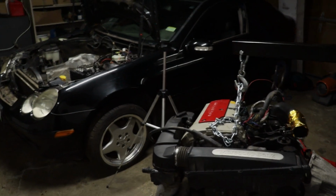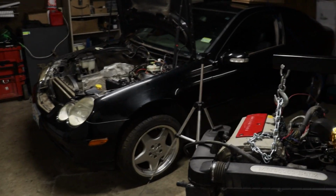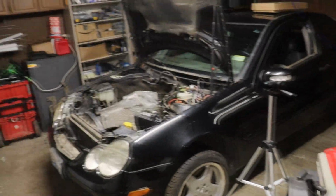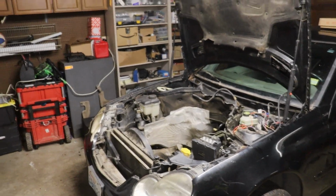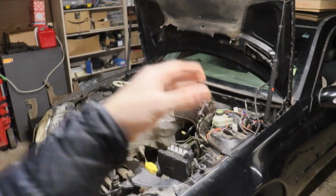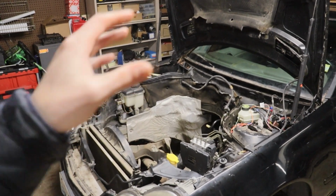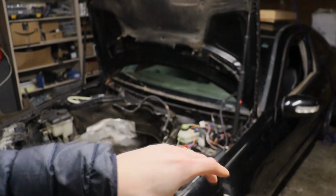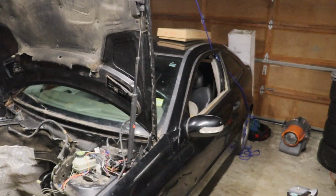So behind the scenes, you guys saw Wednesday's episode, the return of Benzin on a Budget, episode 8. Finally got the M111K pulled out of the coupe here, and I actually need to get this thing out of the garage. So that's the first thing we're going to be doing in the video. I pulled the front SAM, not thinking that I'm going to have to get this thing out of the garage again. So I got to put the front SAM back in, put the battery on so I can at least have power to the key so I can get the steering wheel to move freely, just so I can kind of back it out to the same spot, roll it out.